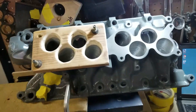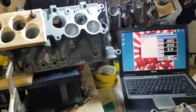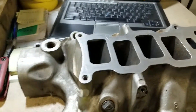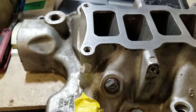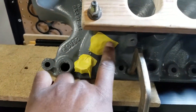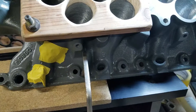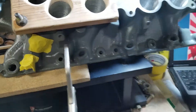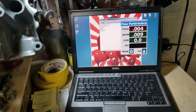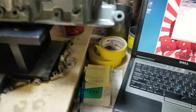As you can see, we have the radius — we had a radius for the Track Heat also. The Track Heat number five had a plug on it right here, and we have the number five on the ported GT40 that was also plugged up. We're going to flow it on the same bench. You see the calibration is zero, so we're going to turn on the vacuum source and see what this bad boy does.